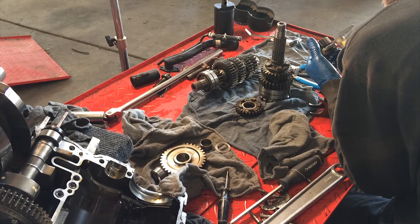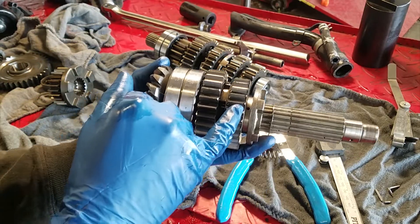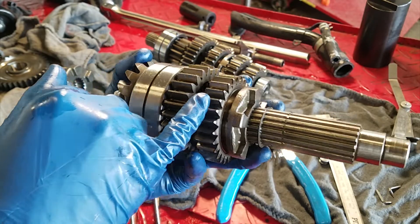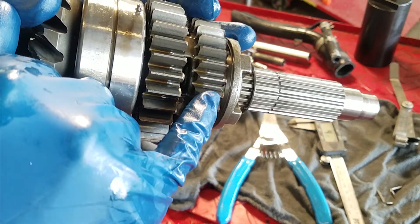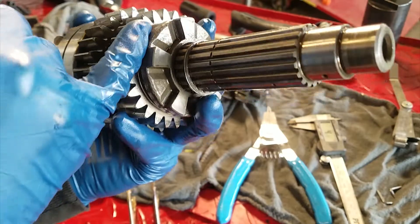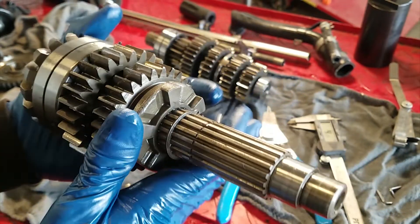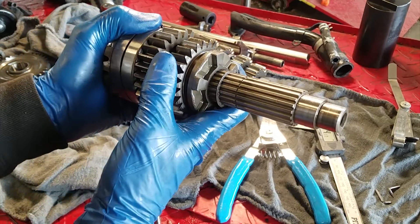5.19 — and visually too you can see that there's damage. We've got a heat ring on it. If you look at the very edges you can see some blackening — blackened right into the metal. You were definitely getting discoloration because this thing was rubbing on there, creating friction, making heat, and grinding it down to nothing. This is definitely our problem as far as this bike slipping down to second and third gear.